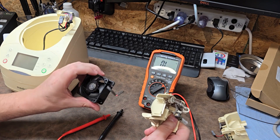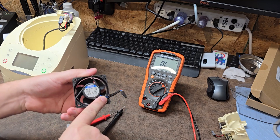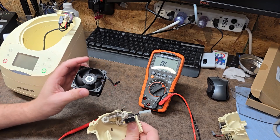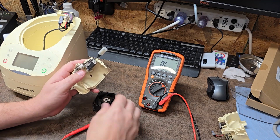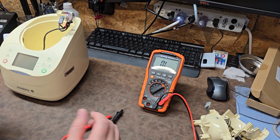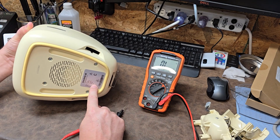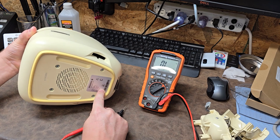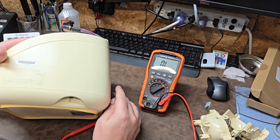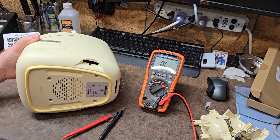The fan is right here - you can see it actually gets pretty dirty; see the backs of the blades? Those fans get pretty dirty. But if the fan ever failed, you have this thermal disconnector right here. That is the heating element. We know it pulses electricity because at six ohms it would be way higher than 2.5 amps - 2.5 amps is extremely low. Pretty interesting; I'm kind of fascinated by it.